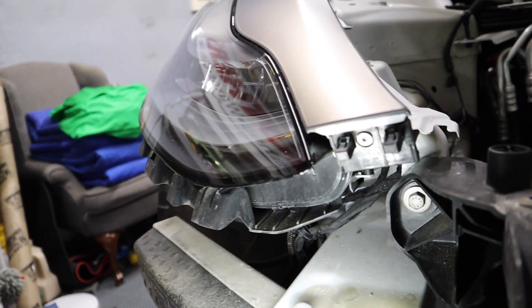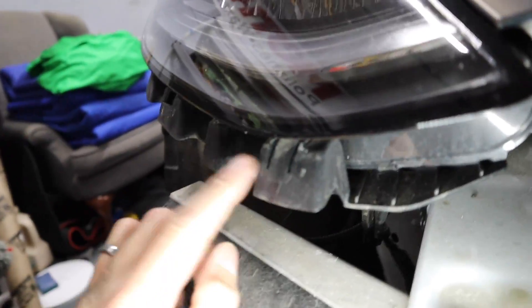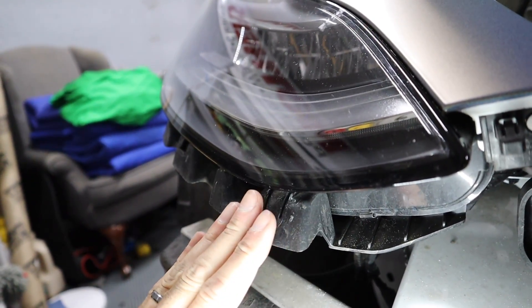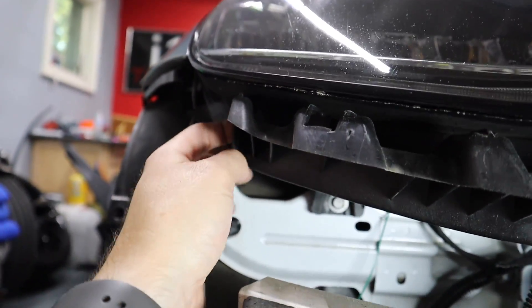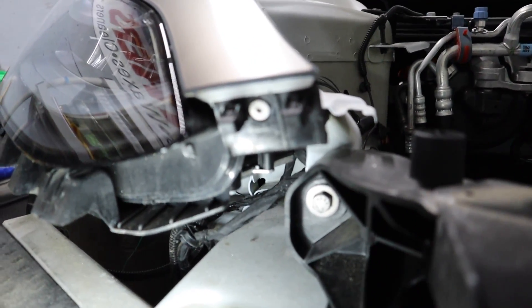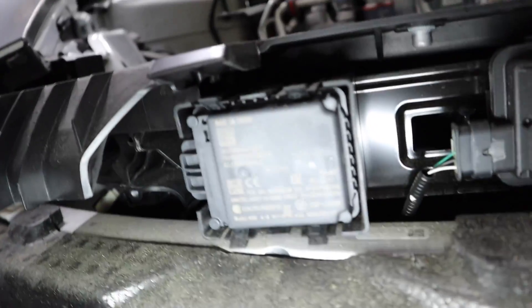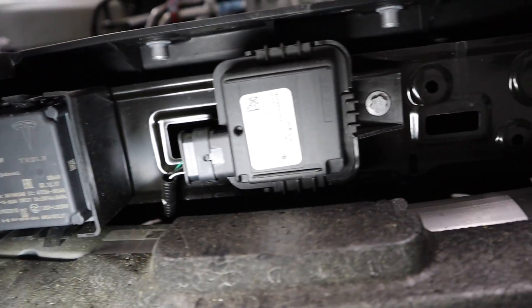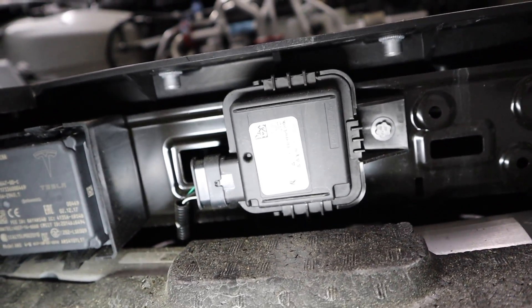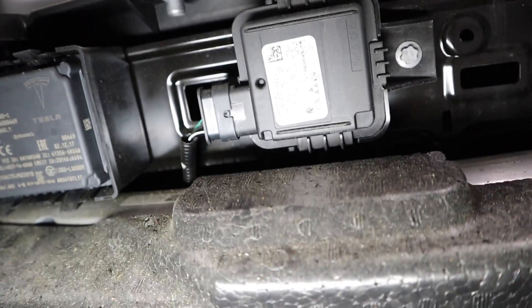There are the louvers for the cooling systems for the battery, and it looks like there are the horns. That's the wiring harness that comes down. This green wire I disconnected because that's what my fog lights were — the ones that synchronize across. One of the reasons I took off the bumper is it's going to be easier to wrap. Also, one of the mobile service guys said there were tabs here, and if I put something here it'll push the bumper out flush with the light — because there's no reason for that to not be flush. The newer cars do have it flush. These clips are the hard parts of taking off the bumper — they're really strong. You just have to get in there and pry back a little bit. Up front there looks like we have the radar. This is the home link. Some of the new cars now don't have the home link from the factory — you have to buy it and install it, and they'll have to take off your bumper to install it.